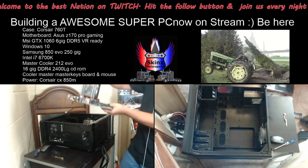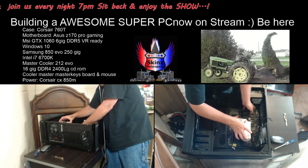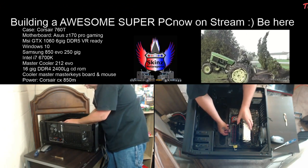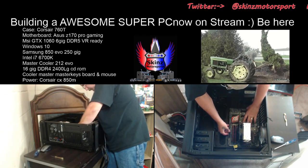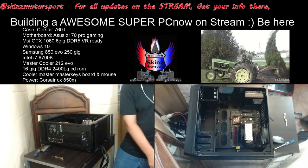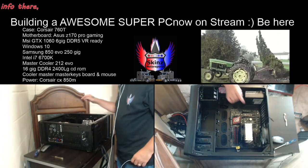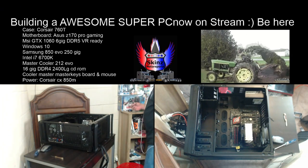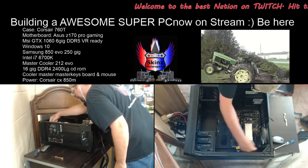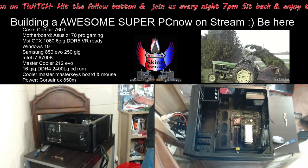Lifting them together into the case. Do not support all the weight on the master cooler. Make sure your cooler fan is out of the way. Pushing the motherboard into the slot that's designed by the case. And then now we want to install the screws to the motherboard. We're going to need 1, 2, 3, 4, 5, 6, 7, 8. 8 screws.